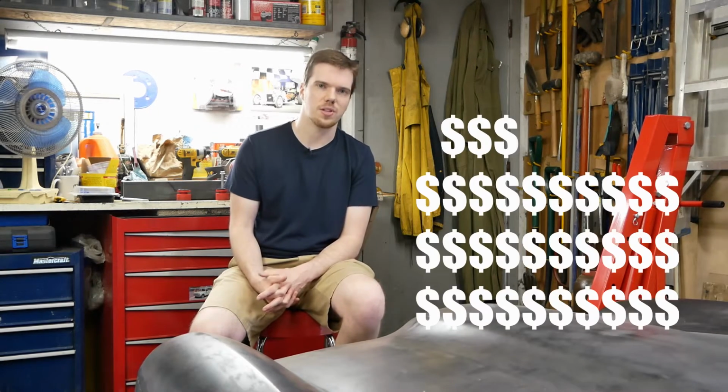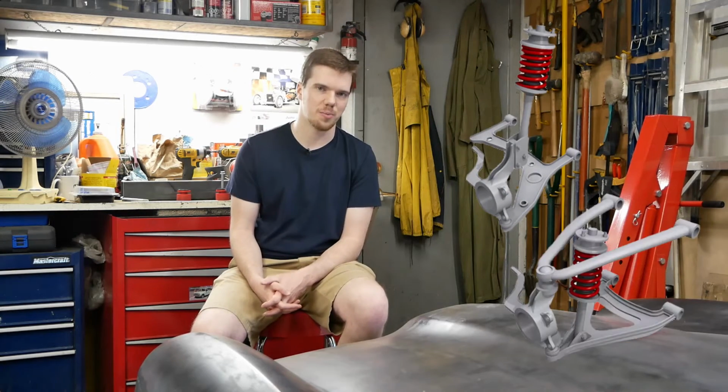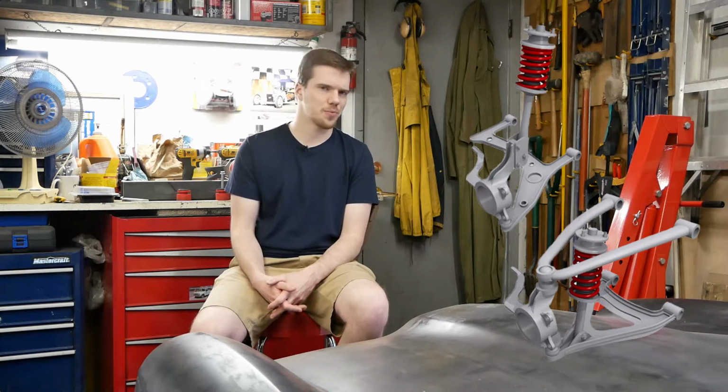This poses a whole new problem though, as most cars use CV axles, which may not sound like a problem at first, but keep in mind if you need to narrow one, anything short of cutting and sleeving is going to require whole new shafts to be made, which will run anywhere from $600 to $2,000 around here, which is no. Not to mention that having CV axles will also mean we will either need McPherson or double wishbone style suspension, which takes up room we don't really want to give up. This just left us thinking, wouldn't it be nice if there was a solution that could take care of both of these problems at the same time?